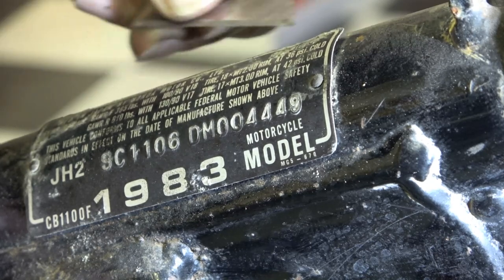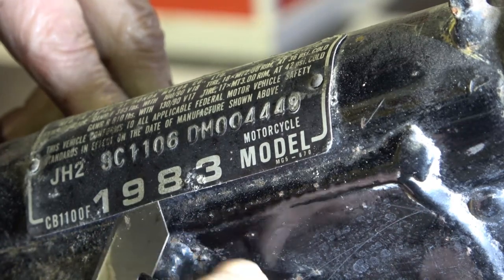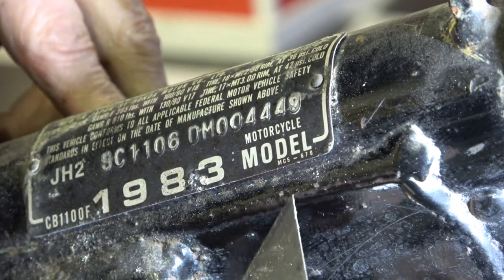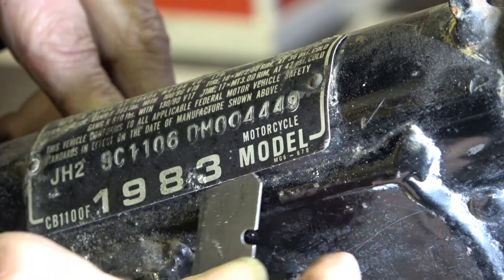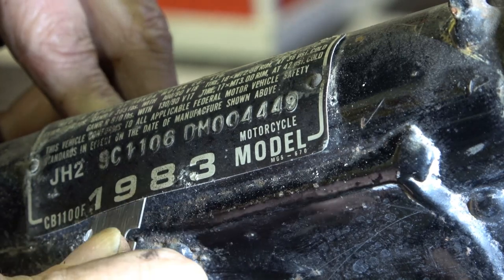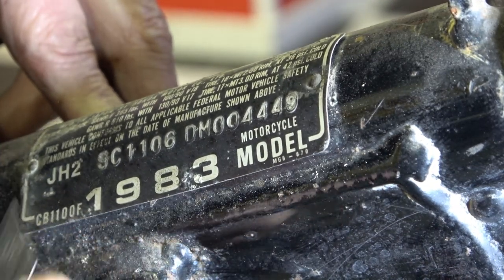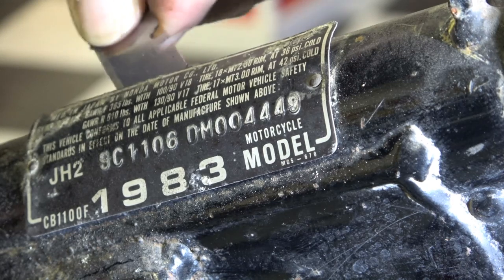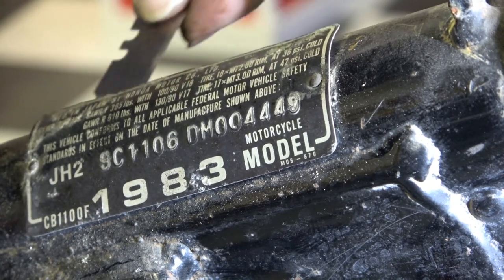As you can see, the brads are loose on there now because the tag is moving around quite a bit. As you scrape away at the glue the VIN tag will start to separate from the frame. The act of doing this will actually pull the brad out a little bit even farther than what you pushed it out with the special bolt — you can see the brad sticking up away from the VIN tag. I'm doing this in real time just to show how long it takes; it really doesn't take very long, you just have to be really careful.